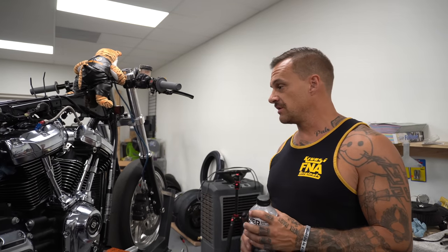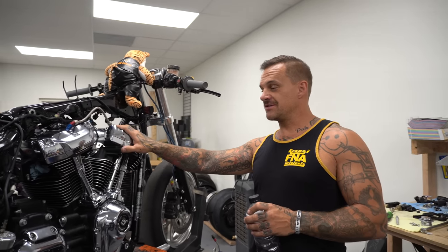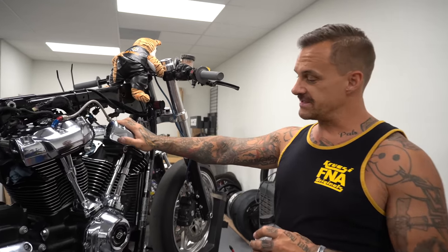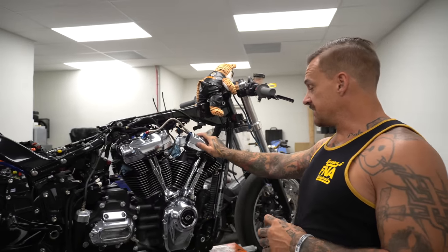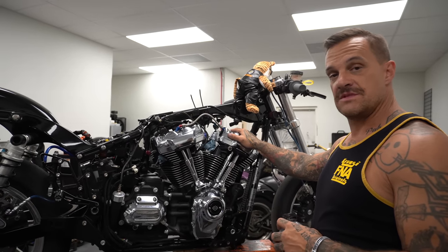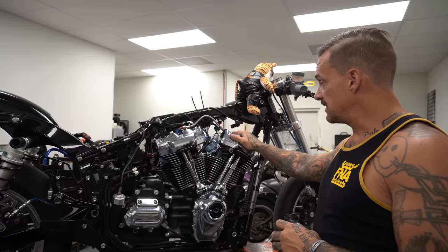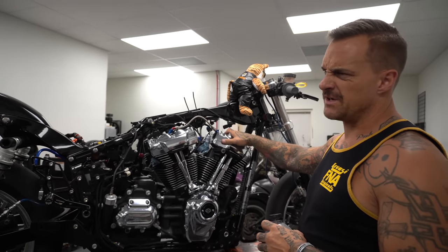That's it. It's together. Throttle body will hopefully be here tomorrow, and everything else will hopefully be here tomorrow. This is an S&S 124, two front cylinders, machined to fit, with an S&S full cam chest kit with 550 cams, stud retainers, these retainers, everything dialed S&S, really top to bottom. She should rip, man. She's about 12:1 compression, 11.75, I think.